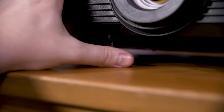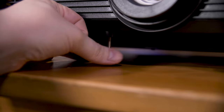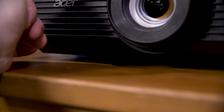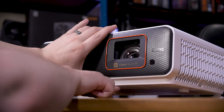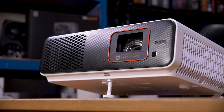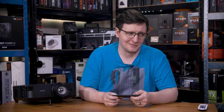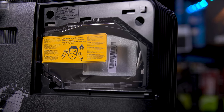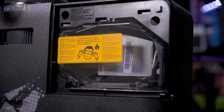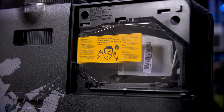If, like my very temporary setup, you're resting the projector on its base — like on a desk or something — it does have two threaded legs: one in the front at the center for tilt adjustments, and one of the two rear legs for more horizontal balancing. These are fine-pitched threads, so adjustments can take a while, compared to the X500i which not only used a very coarse thread but also had a sort of free movement latch — you just pull it, pull the foot out to whatever height you want, and then do the final adjustments. The last thing to mention about the physical aspect is that the shell is really just the same shell they've been using for years. That's made abundantly clear by the bulb replacement hatch — this is an LED DLP projector with no easily replaceable bulb, and yet they still have the hatch with a 'wear protective gear when replacing the bulb' sticker.